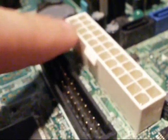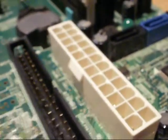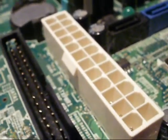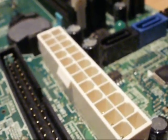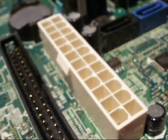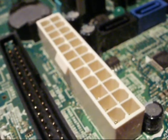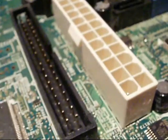Further back we see the motherboard power connector. This is a 20-pin motherboard power connector — this is what the motherboard gets its power from, and it'll be hooked up to a 20-pin connector from the power supply. Some other boards now feature a 24-pin connector, so it'll be slightly longer. In those cases it doesn't matter, because the four extra pins come on a separate wire that you just clip on. So it doesn't really matter if you bought a 24-pin power supply and want to use it with a 20-pin motherboard.